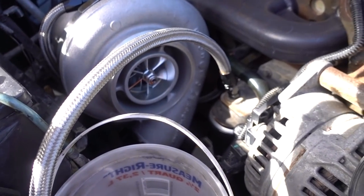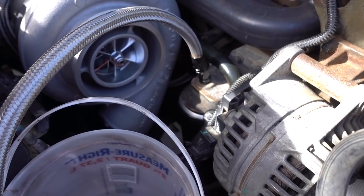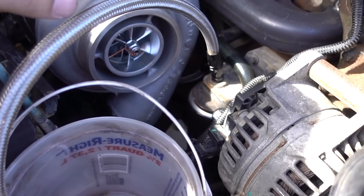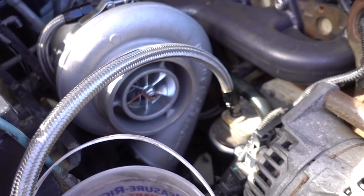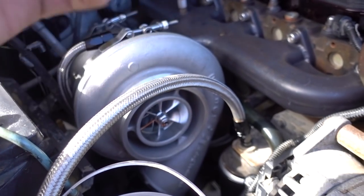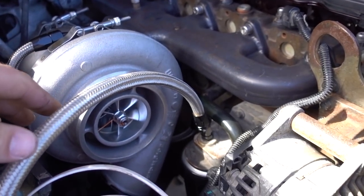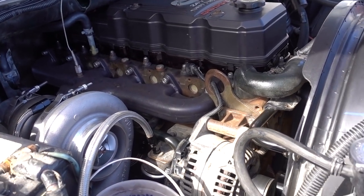Andrew's not feeling really well right now. We do not have great news for you thus far. We put my oil pressure gauge on here, hooked it up temporarily — did not see anything. Went so far as to get an open hose into a bucket and do not have any oil when we start the motor. So unfortunately that's where we are at with Andrew's truck. It's very possible that was the issue with the last charger — possibly took out the charger before it wiped out the entire motor. Possibly the oil pump was getting weak on that trip home where the turbo died. We are not honestly sure right now, so we will keep you guys updated as we unravel the mystery.